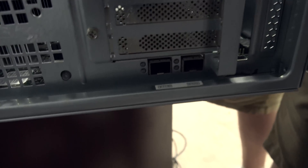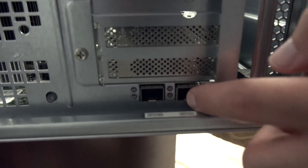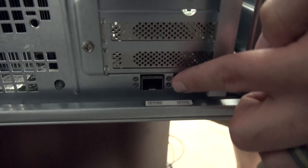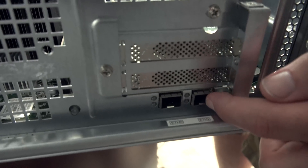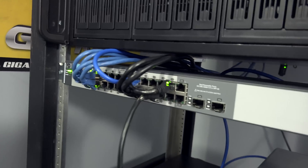But here's the catch — something I have to figure out that I'm hoping will be resolved by something I ordered on eBay: network connectivity. As you can see, there are two Ethernet ports — Ether0 and Ether1. These are actually SFP ports, and there's one standard Ethernet port over here. I learned something I really didn't think about before: on some of these enterprise-class server motherboards, the Ethernet port on the back is only for the motherboard itself — the BIOS connection. It doesn't actually provide any link with whatever system you're using. Did not know that. When I plugged the Ethernet cable into my switch, all it did was give me the BIOS management screen. It did not allow me to connect to the FreeNAS that was pre-installed.